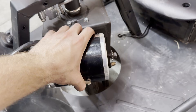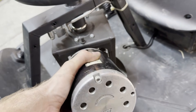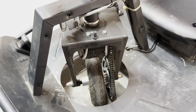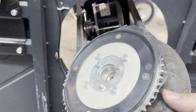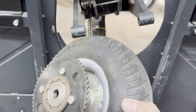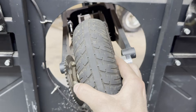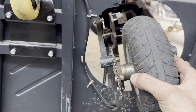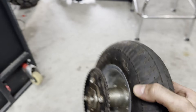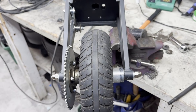A lot of people like to upgrade these by going to 48 volts and a larger brush motor, but I'm just going to skip straight to the point and go to 72 volts and a brushless motor. I'm going to start by upgrading the tire. This little solid tire isn't going to have enough grip for the power this thing's going to have, so I'm going to use an E300 tire that's a bit bigger. These dropouts need to be widened a bit, but that doesn't look too hard. Since this new tire is a larger diameter, it'll make the cart sit higher in the front, but I think it'll be fine.